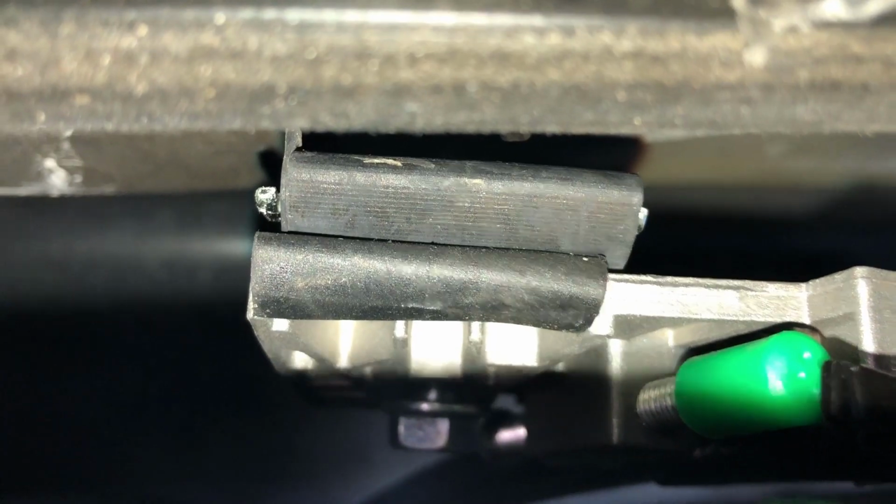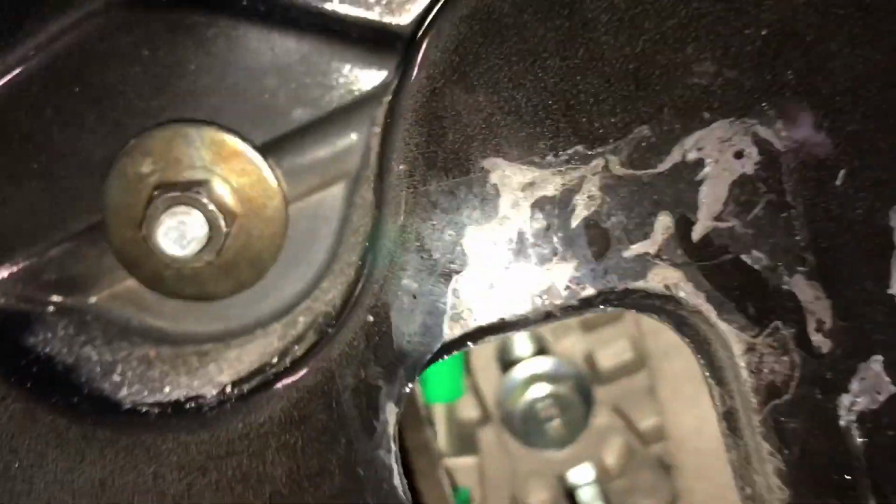So next, you have to loosen these clamps here that we have on the inside of the door. Now to loosen these, it's just these bolts through here like I said. And when you loosen them, you're going to want to loosen them so you can get about your finger in there. You can get your finger in each of these. Oh, two at once, you never thought you'd be doing that. And once you can get your finger in both those, then it's okay to go ahead and put the glass in. So let's go ahead and get that lined up.